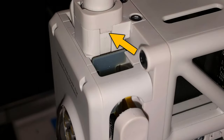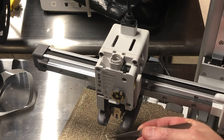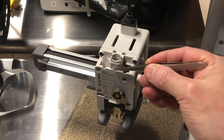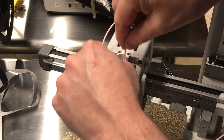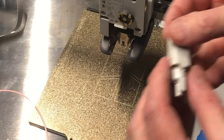Next, to release the collar on the filament hub, get a small tool — I'm using tweezers — under that little tab and push up. The filament hub will release; it's got a small ridge on the front and back, and when you apply pressure under that tab it'll pull up. As soon as I did that, the little piece of filament that had broken off inside and was causing my jam fell out — and that will likely happen for you. If it doesn't, feed a piece of filament, pull the extruder lever on the left outward, and work it all the way down through the system until it pops out the bottom, pushing out any broken filament.